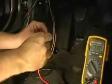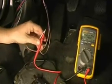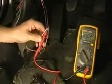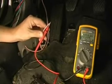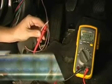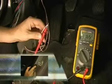This is a digital multimeter to show you how I found the correct wires. Now, I go to the door trigger wire and then I go to the door trigger switch, which is normally located on the door. Right now the door is open and it reads zero volts. When I push the door closed, it goes to 12 volts.